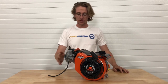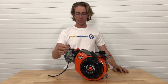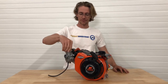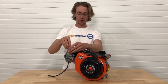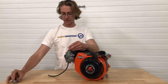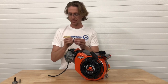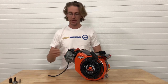To remove your carburetor from the 206 engine, first loosen the locking cap for the throttle slide mechanism at the very top of your engine. This can be done by hand — it should be nothing more than slightly tighter than hand tight. Once you loosen this, beware there is a spring in here that actuates the throttle slide moving up and down, so make sure you don't lose that. Simply pull it off, set it aside, remove the spring, and with your pinky finger reach in and pull the throttle slide mechanism out. Set those aside on a clean towel.